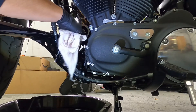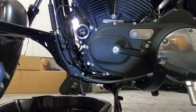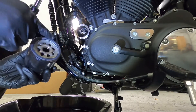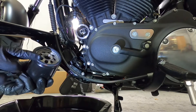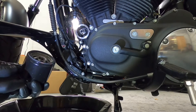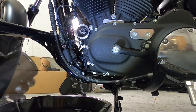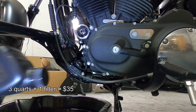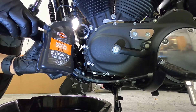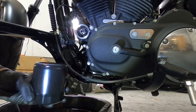That's pretty much done draining — wipe all this excess off and make sure it's nice and clean before putting the new filter on. On the new filter there's this black gasket which will suck right up into that section. What you want to do is put some of the oil you're going to add into the filter before you install it — probably only halfway to three-fourths of the way up — so you can tilt it in and then tighten it. Being a Harley with low miles, I went and got the 20W-50 from Harley, which is what they recommend.